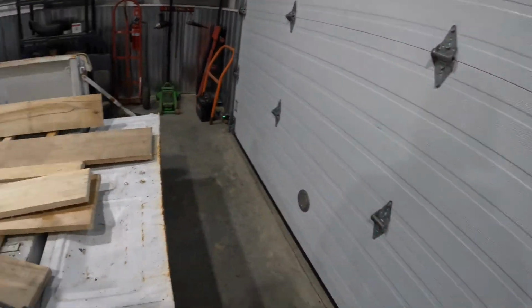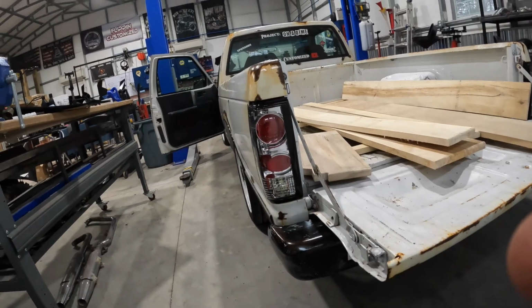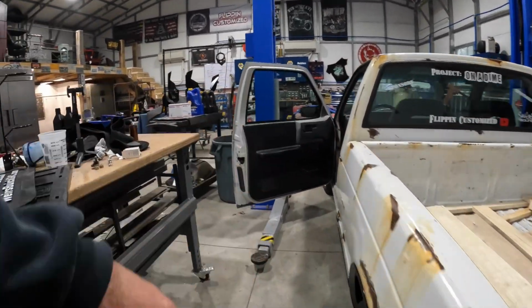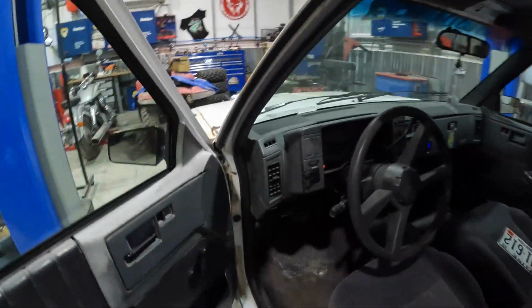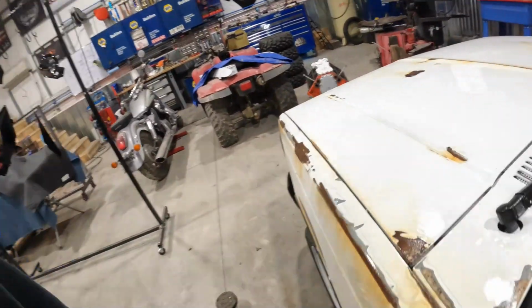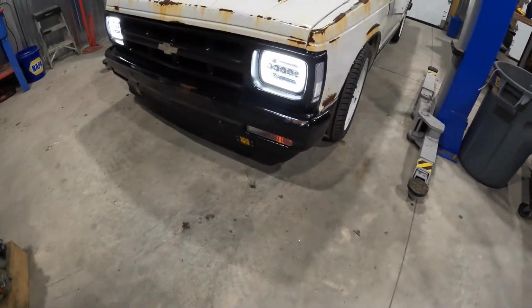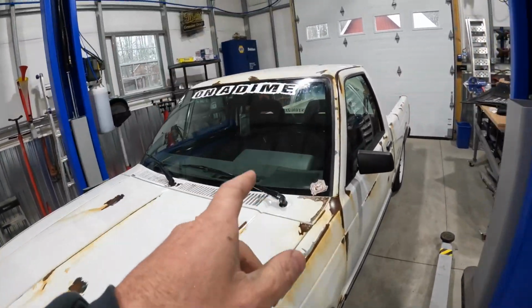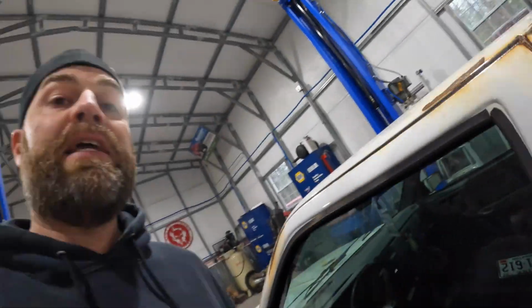I'll show you. Blinkers on, here we go. Remember, these are strobing lights. So it actually gives a strobe. The blinker's not blinking fast, that's a strobing light. And see, it's going normal. Then if you go into the front here, it's also going normal. And these are all LEDs. So we fixed our problem with that electronic flasher, and I'll put the link in the description for that as well.